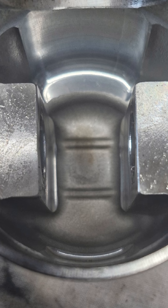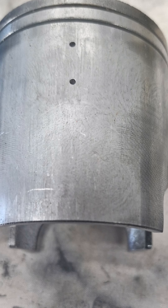So again, quite lean. Looking at the side of the piston — this side is the exhaust side, and that's the bit that gets the hottest. Hopefully you can see on the picture there that there's quite a bit of scoring — again, not bad, but definitely worth changing. It suggests it's been getting hot, meaning there's not really enough fuel to keep it cool. The richer it is, the more fuel there is and the cooler it runs. Obviously you don't want it too rich because then it doesn't run quite as well — it's a fine balance.